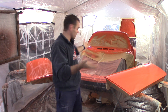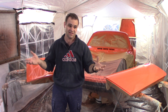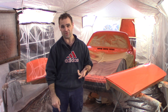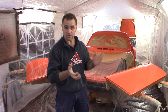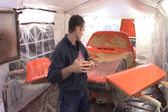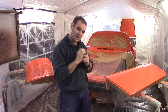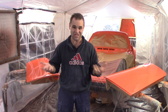Alright guys, that's it for another episode. Colour is on the body and the doors, as you can see. I wanted to get all the body panels painted but the sanding just takes so much time — sanding it all back with 400 grit, then going over it again doing all the little touch-ups, then going back over with 800 grit and masking it all up and painting it. So next episode I'll get on to showing you painting the rest of the bits and pieces. The finish I'm quite happy with how it's come out. There's a little bit in it and a couple of runs, but that is not the last clear coat this car is getting — there's more to come, so this will all get chopped back smooth. Because I'm doing the paint job properly. And there might also be some graphics going on this, so I'll let you guys speculate as to what you think I might be doing.